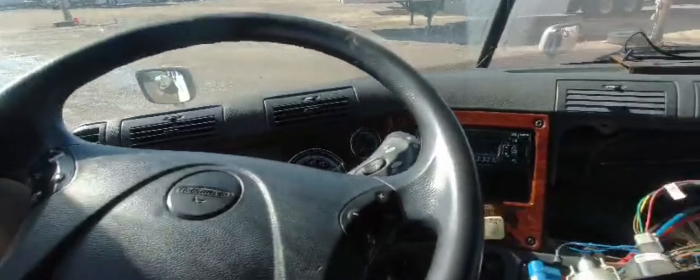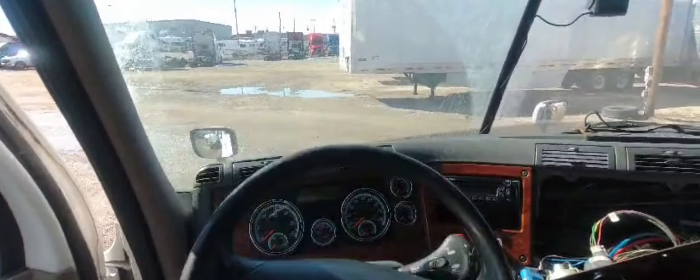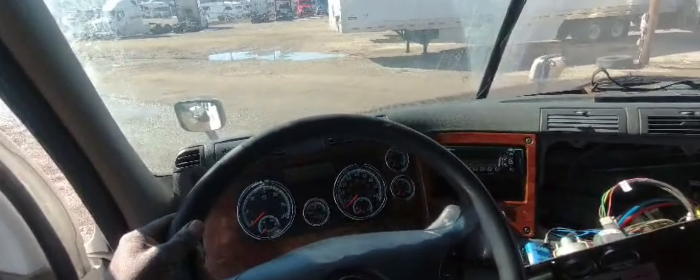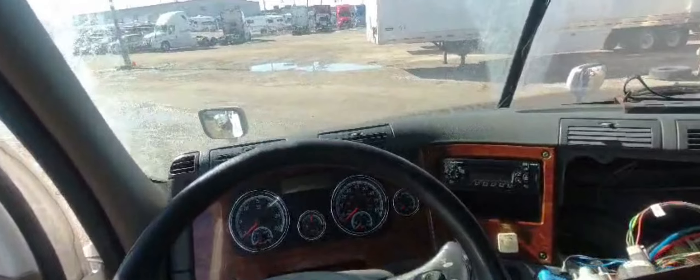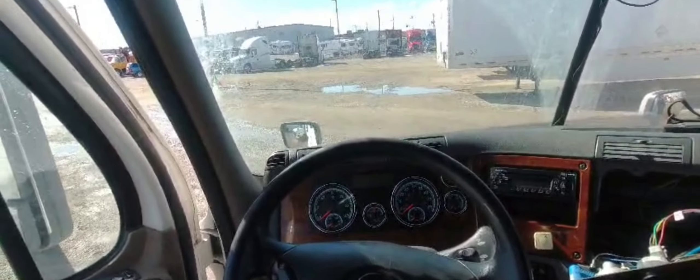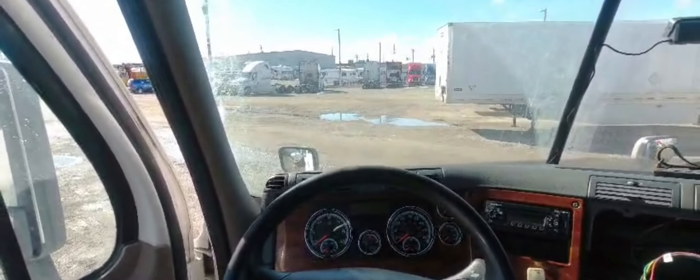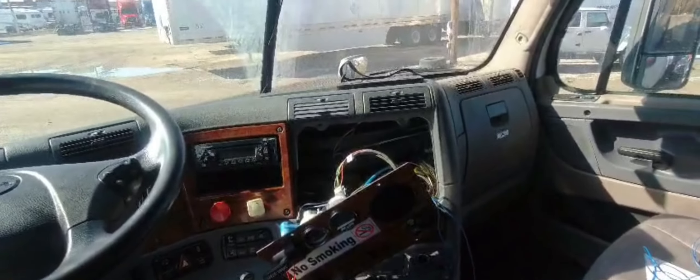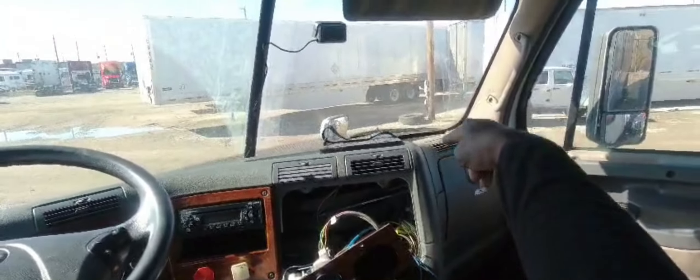You have to reach in to push the button. With the steering column in the riding position you can't even reach the button — that's what I like about it. You can't see it and you can't reach it in normal riding position. You'd have to know where it is and intentionally lower the steering column to be able to reach it and start the truck. Now I'm going to move that way and run the wire across and out into the engine bay to reach the starter relay.